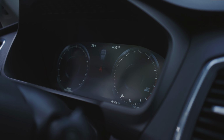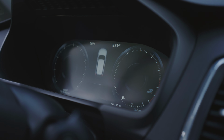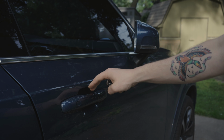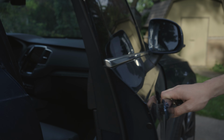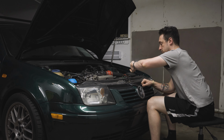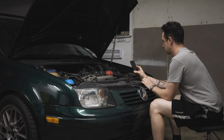Some cars may have an under hood light or a switch just like a door. Make sure that the light is off and the switch is tricked into thinking that the hood is closed. On modern cars with passive entry, make sure that the key is out of range so the car isn't searching for it. Now you need to wait for the car to go to sleep. Older, more simple vehicles can take just a couple minutes, while something newer or a car with a lot of luxury features can take 30 minutes to an hour.